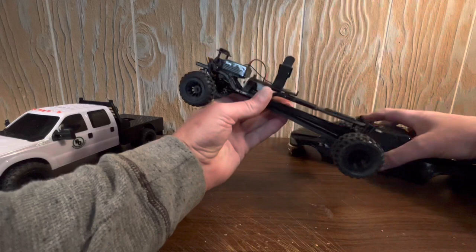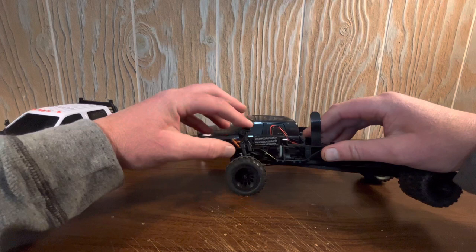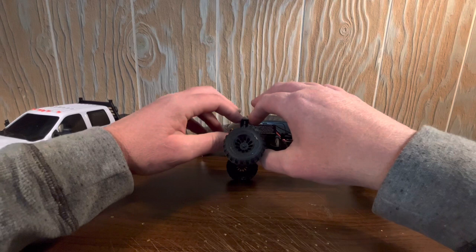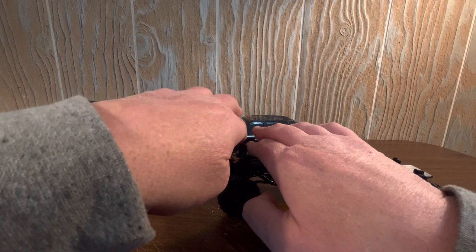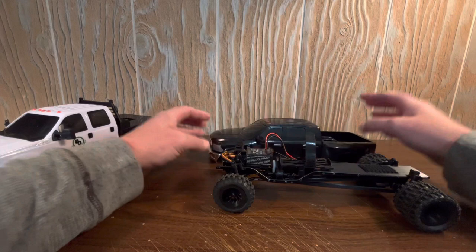Oh, and if you order the stretch kit from SKP Engineering, you don't need this front mounting piece that comes for the Chevy, the one I hope you saw in the video a little bit earlier, where it's kind of like a step. You don't need to use those on the Dodge and the Ford, because on the inside of the Dodge and the Ford, where they mount, it's flat. So you can just use your stock mounting piece for the Ford and the Dodge,